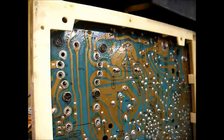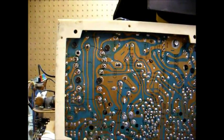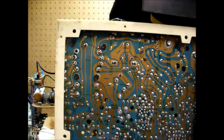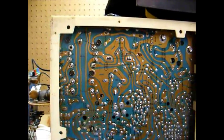We have our replacement flyback physically bolted to the chassis. All that's left to do now is re-solder each one of the pins, connect the high voltage anode lead to the picture tube, and solder the lead to the focus control. The flyback transformer is soldered to the chassis and we're just about ready to run the smoke test. Once again, I'm going to use the standard 100-watt incandescent light bulb in place of the B-plus fuse and see what happens.